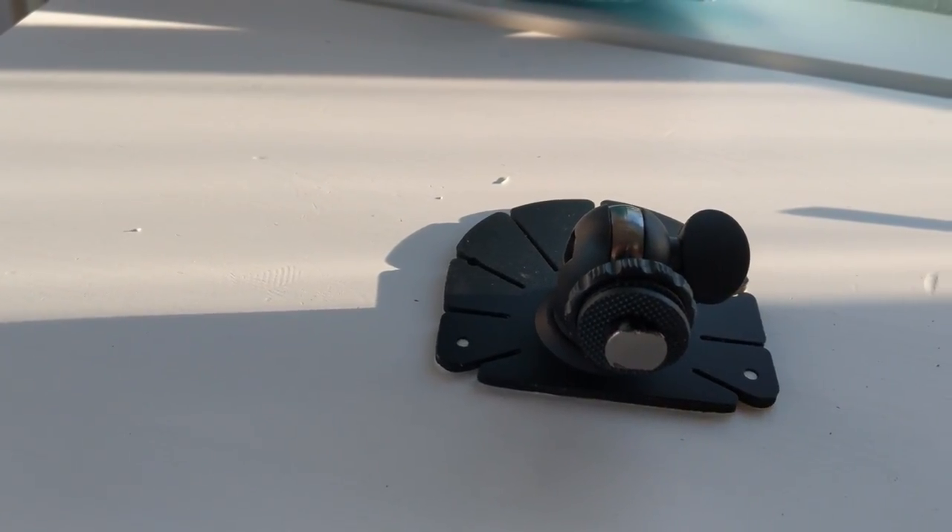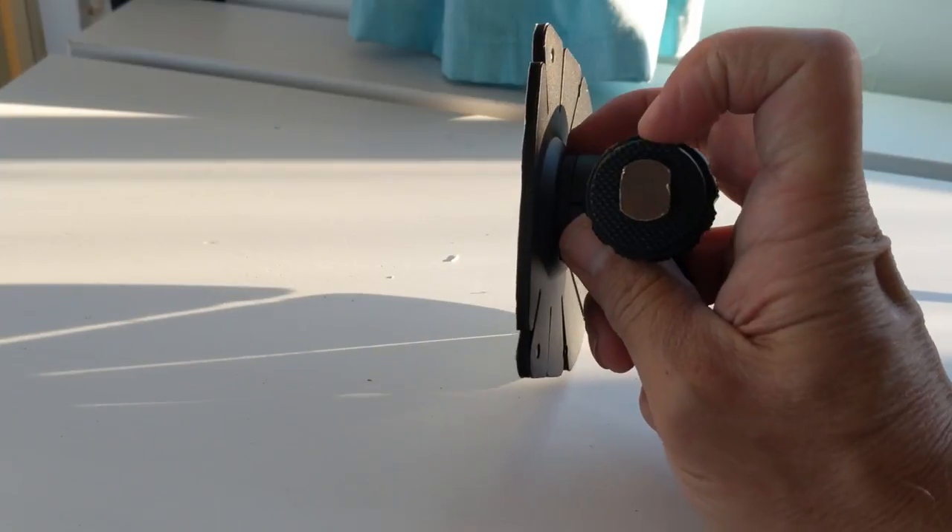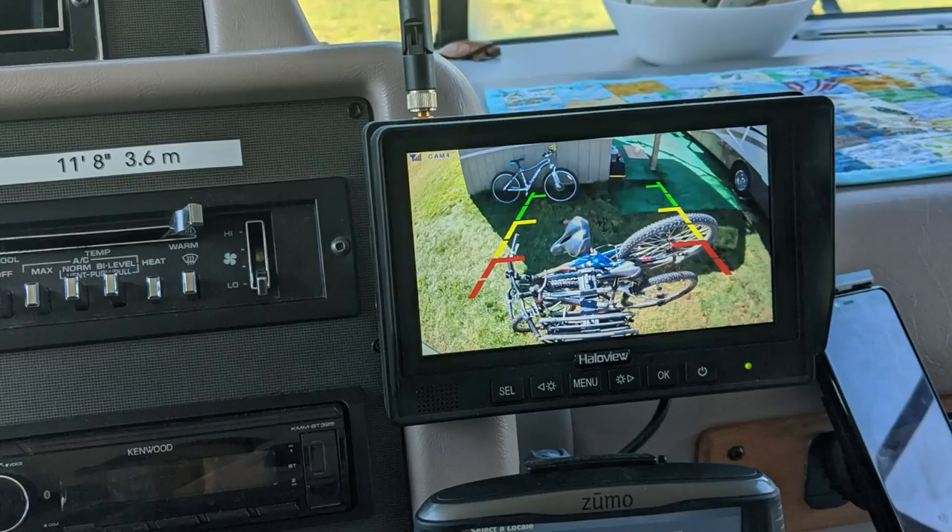While I was helping Garrett on his halo unit, I was thinking about how I'm going to install mine. I took the plate that mounts the screen to the dash and I modified it — I turned it 90 degrees. So now I can mount it in this direction on the side of my dash and have it fit into the slot correctly. We're ready to do the install on our screen and I'll be installing the camera on the very back using a metal square and a magnet, so I only have to power the unit and I'm done. I'm taking off the light housing to gain access to 12 volts.